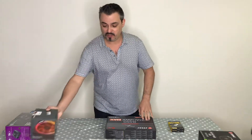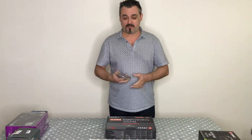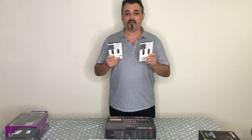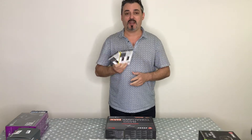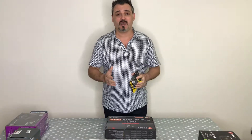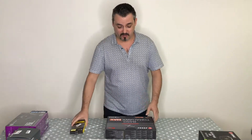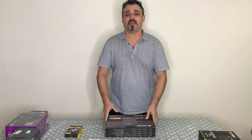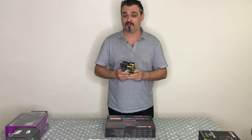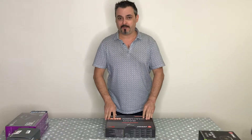As I mentioned, RAM is very important. I'm going to be using fast RAM — 3,000MHz — and altogether 64GB of RAM. You need to make sure the computer can be upgraded in terms of RAM, which is why I chose this motherboard. It can take up to 64GB across four slots.